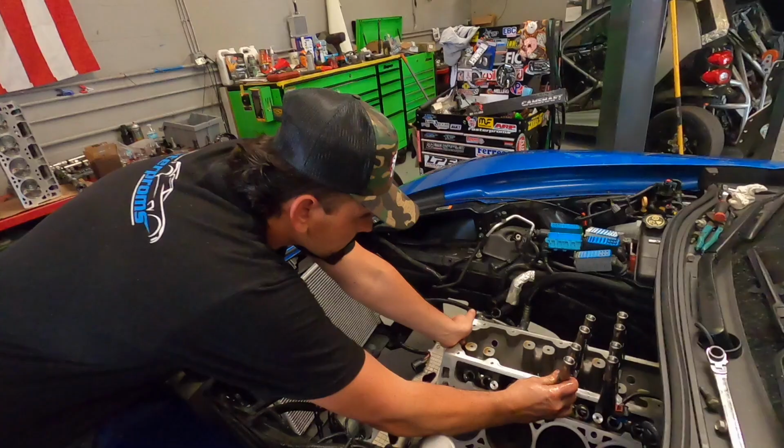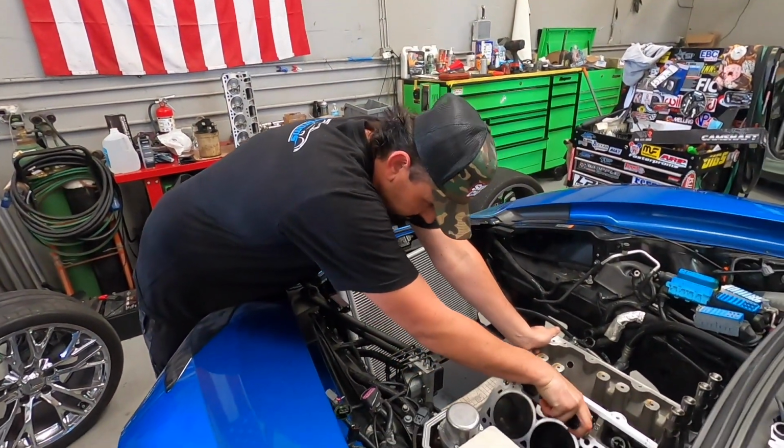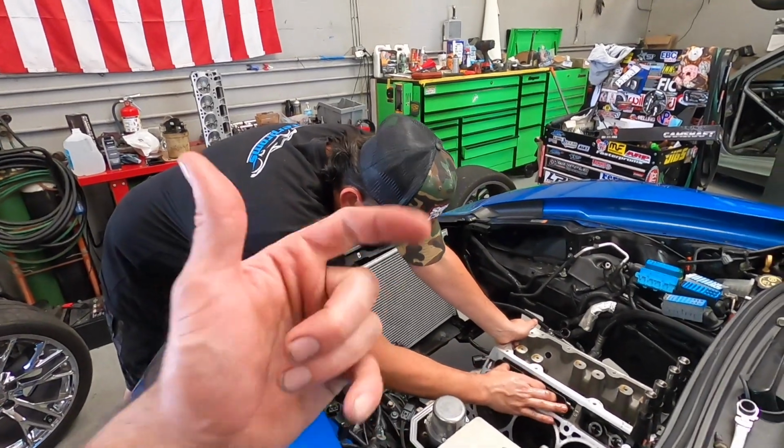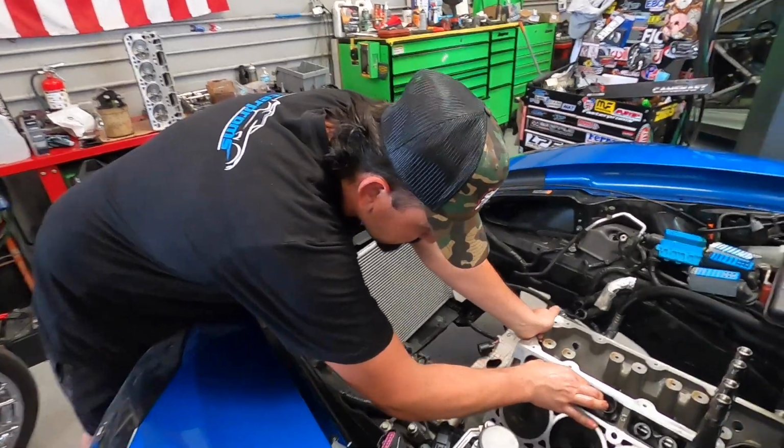It really steps up the octane. So you're going from a 93 octane to pretty much right about 112 octane when you have methanol and E85. A gigantic difference in timing and a big difference in power as well. Methanol being highly oxygenated, and E85 is pretty heavily oxygenated as well.